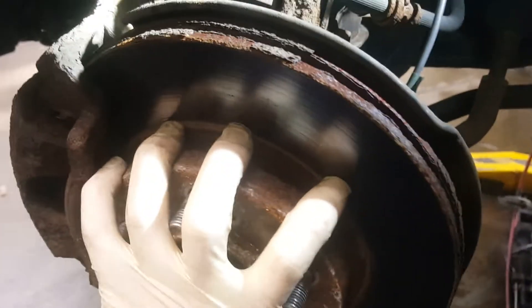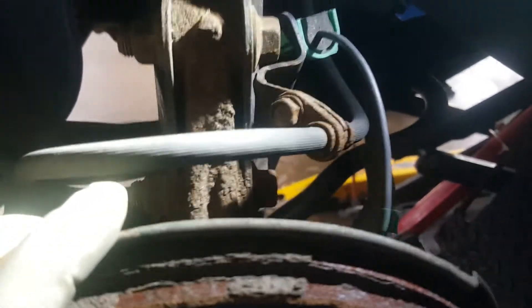This sensor is the same as the passenger side sensor, so you can actually take these sensors out and swap them from side to side to see if the light goes out. You also want to check your wheel bearing — make sure your wheel bearing is tight. With the wheel on, just take the wheel side to side to make sure the wheel bearing is good and tight.